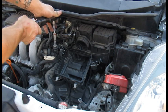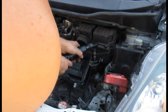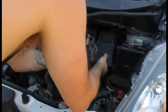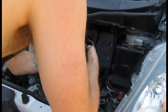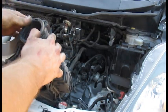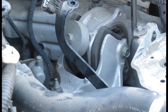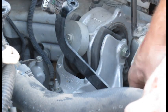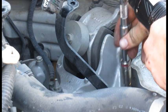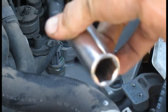Go ahead and take this bracket off. It would probably help to take some other stuff out of the way, but if I don't have to take it out, I'm not doing it. This is when it's important that you've got that jack under there supporting the transmission, because what we need to get to is under this mount right here. I'll get this bracket out of the way — there are two 10mm bolts right down here. Then I got my deep well 17 for the mount bolt.